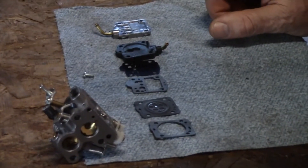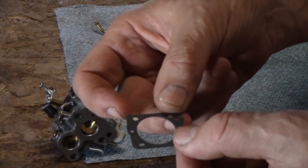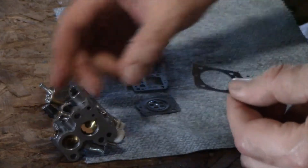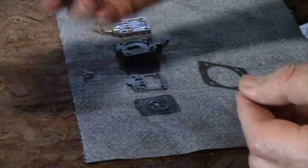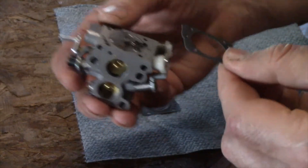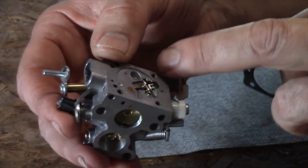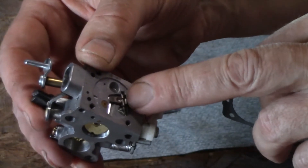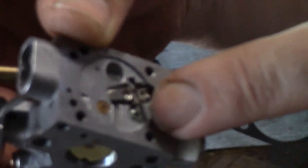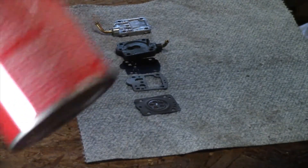Here are the parts we're going to put onto the carburetor. First, we're going to start with this paper gasket. All these parts are OEM Husqvarna parts that I ordered. Some parts are original to the carburetor, but I bought the rebuild kit. I took the needle and seat out, along with all the components retained by this small screw, and cleaned them out with carb cleaner.